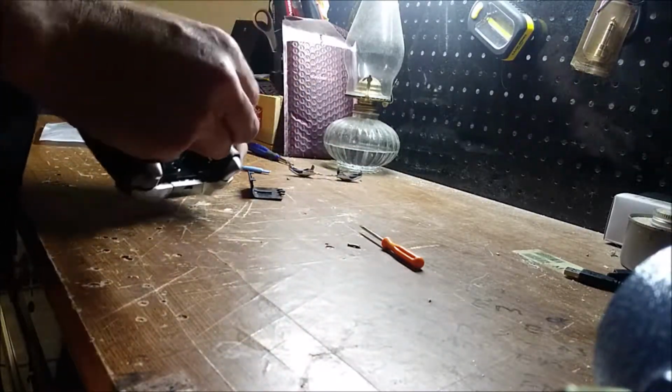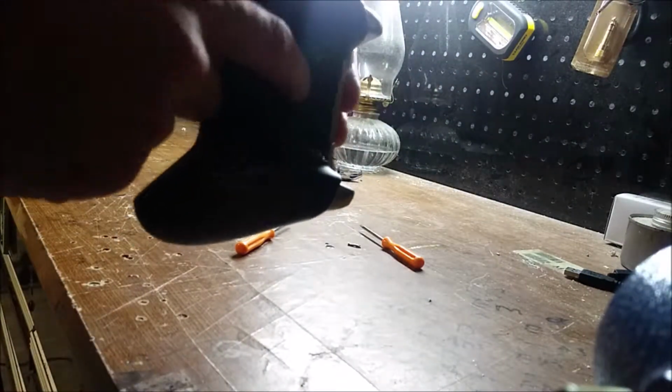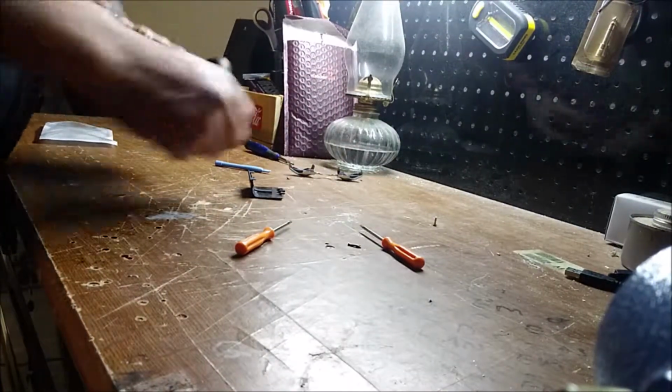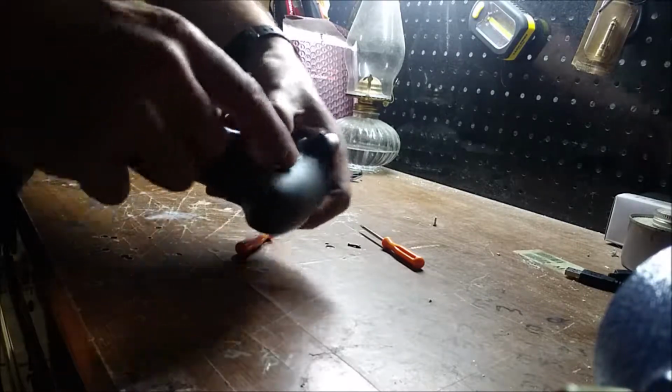And so there's a screw underneath the battery in the battery compartment. Now chances are you will not see that screw to begin with, because the Xbox comes with some warranty bullshit paper over there that you have to peel off to get to that hole. Now the next is the tricky part. You gotta pop these sides off here to get to the screws underneath.